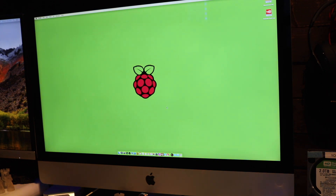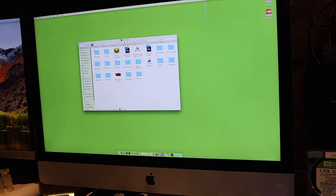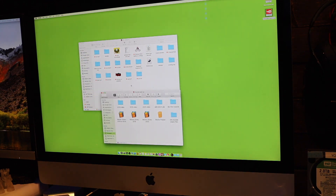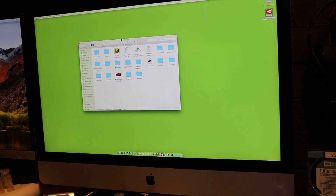So this is what my laptop actually looked like. You can see you're running it actually as the computer off the hard drive. You can go into all your old files — let's go to Finder. There's WG Designs. Boom, there's all the files from before. You can actually work off of this hard drive like you were working on your laptop. You can use your older Mac hard drive to run on your new Mac to continue a project you were doing. Or you can click and drag files to an external drive like I have here, and then go on to your original hard drive and work on it like that.